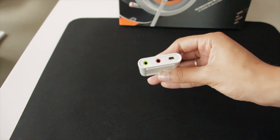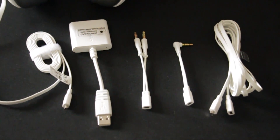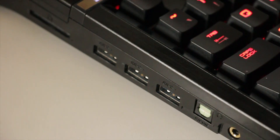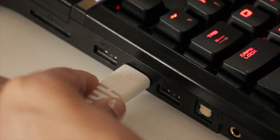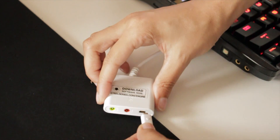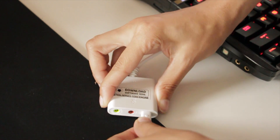To set up your Siberia 650, you'll need to choose a connection. We'll be using the external sound card and 8-pin connector today. Connect the external sound card USB to your PC or Mac, then attach your 8-pin connector to your sound card. The headset will illuminate to let you know it is successfully connected.